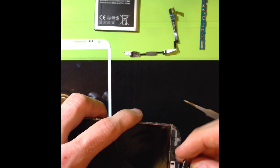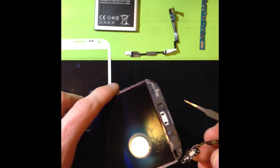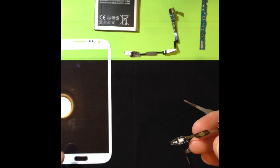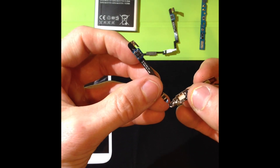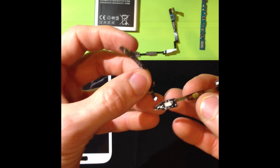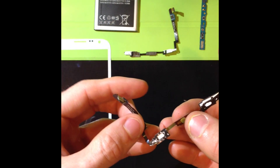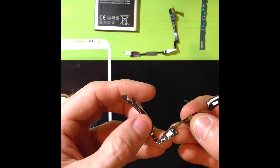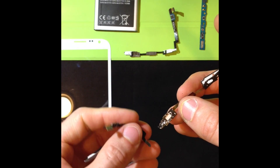It's finally able to get underneath that. See that? There's your problem — the ribbon cable was cut right there. That's something you'll see pretty often whenever people are replacing screens; they don't know that the ribbon cable is there and they'll have their knife or whatever object they're prying the screen off with, and they'll just cut right through it.